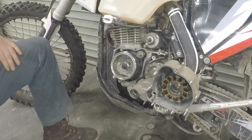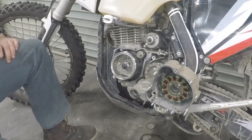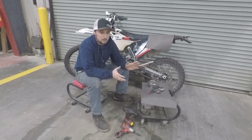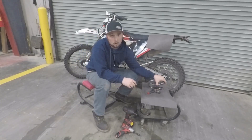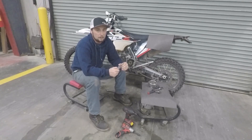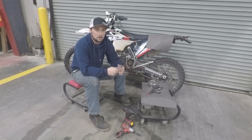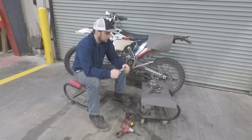Now one thing — what size is that center bolt? I think that's a 14. All right guys, I did get the flywheel off — I did this off camera for a couple of reasons. As you can probably tell, this is not the same day; this is a couple days later. I actually had the wrong puller — I pulled that thing apart and realized the puller I had was about a millimeter too big, so I ended up having to order a 27 millimeter. Luckily Amazon had two-day shipping on that, got it fast, and now we have the flywheel off.